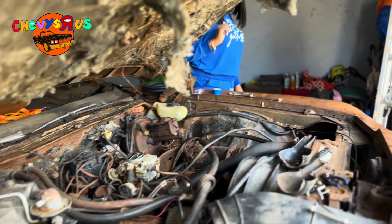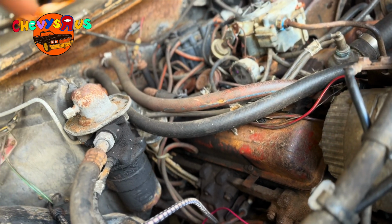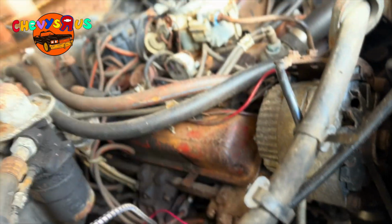Yeah, good job. So now, next, I'm gonna drop the fuel tank, clean out the fuel tank, put the fuel tank back in, and replace the rubber line that goes to the gas tank. And that sucker be ready to roll then. Hey man, that sucker run pretty good, man. So we cleaned the carburetor out and we cut the ends of the vacuum lines off and kind of resealed up everything so no vacuum leak. But that man, I'm really impressed.